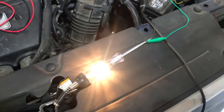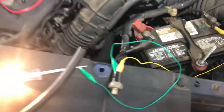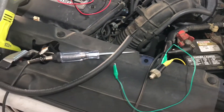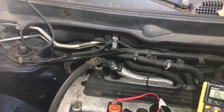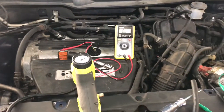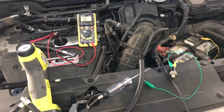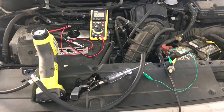It blew off my pressure switch and went flying — so there you go, you get a little bit of a show. But you did see that the test light went out when I hit pressure on the switch, so we know the switch is good. We're still getting the P2646 code and it's jerking above 2600 RPM intermittently. I'm going to have to check further into that reference signal, see if that's it. Otherwise, changing the oil, doing all the standard things, trying to change the filter. But that's the way I tested the pressure switch.